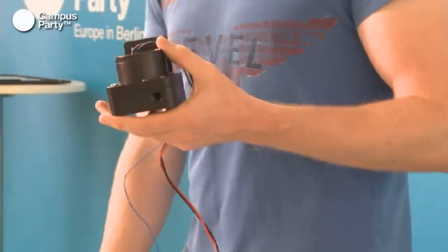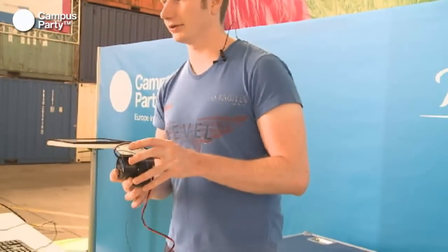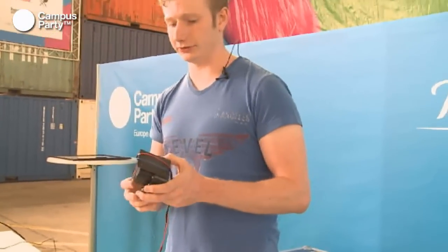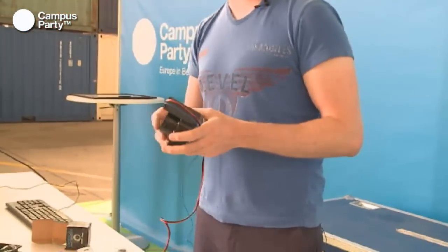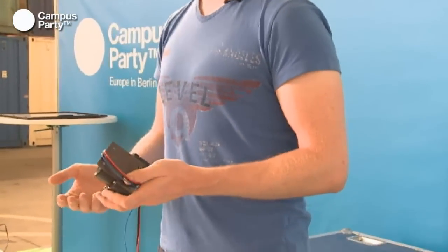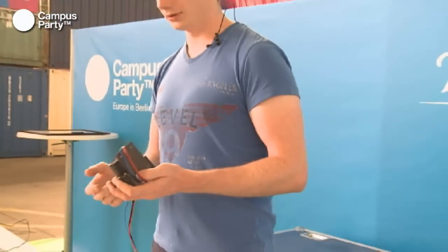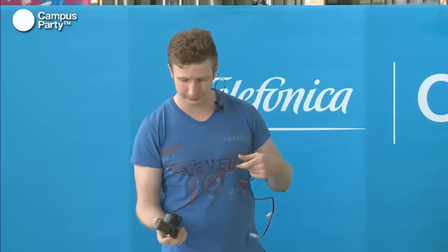And there we go. On this particular pump, you can actually control the pump speed on the back side. So if you think that the pump is too noisy in your system, you can just turn it a bit down. But if you do this, remember to watch your temperatures, because if your temperatures go through the roof, then the water is flowing too slow. So just find the golden middle way where you can have a silent system and some good temperatures in the system.